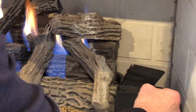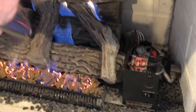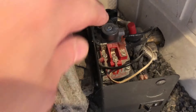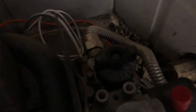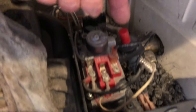Next we take off that cover, just lift it up and out of the way so that it doesn't interfere when you're working down here. And then you'll see inside here you'll have a round knob. It's going to be to increase and decrease the size of the flame. If you want the flame higher or lower, it'll say to increase it or decrease it, or it'll say high and low, and you just rotate it around according to what you would like.